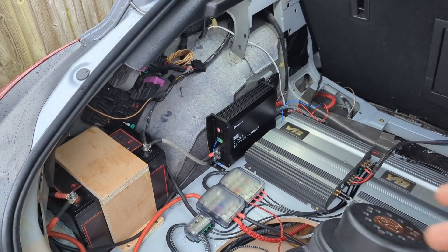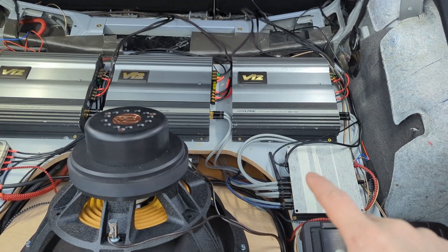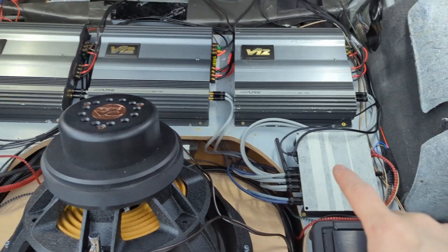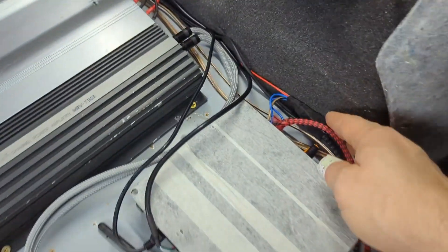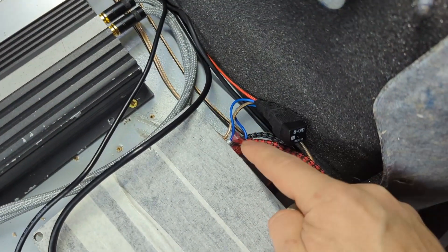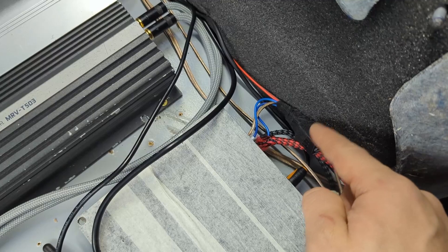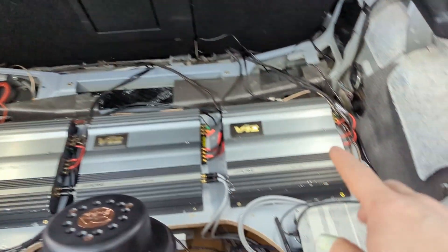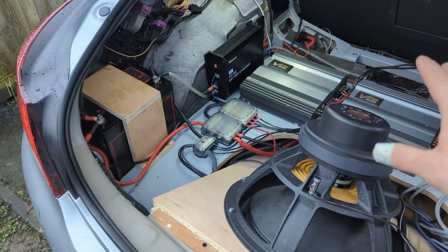For now, just for a week until my relays arrive from China, I wired it directly into the ignition, so ignition-on starts charging. It's not ideal but it's not a problem for a short time. The other issue was the remote turn-on, because the remote turn-on comes from the factory ignition system, but this DSP doesn't share a ground with the factory system. So I put a small relay: the factory remote signal toggles the relay, and the relay connects positive directly into the remote-in.